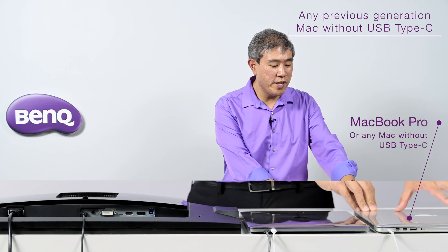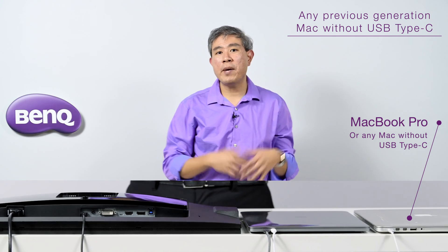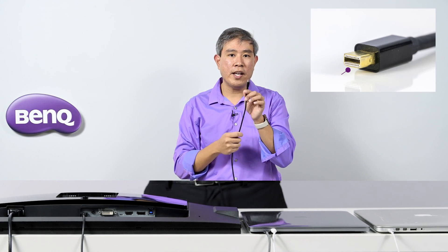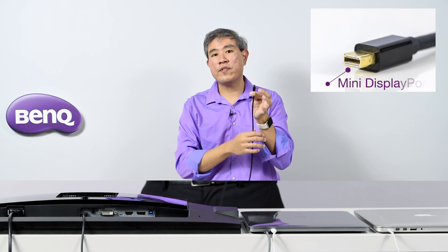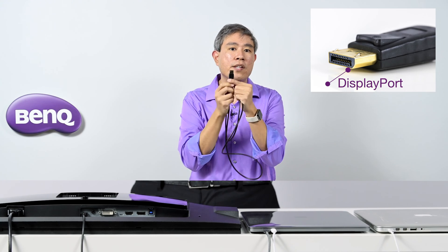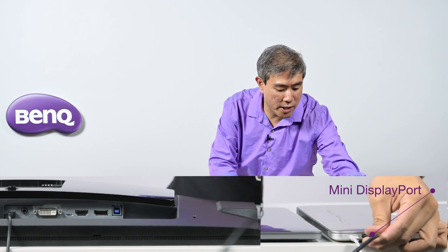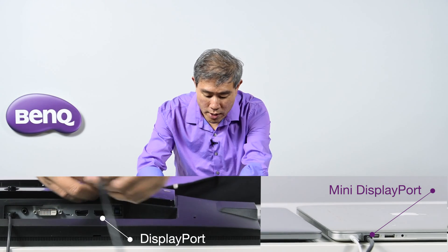Now I'm going to focus on my 2015 MacBook Pro, or anything before that which has all the ports on the side. If you have an older iMac or Mac Mini this will be a very similar setup. BenQ has included the cables you need in the box. In this case we're going to use a Mini DisplayPort — the port that looks really small. It also looks very similar to the Thunderbolt 2 port because Apple implements Thunderbolt 2 over Mini DisplayPort. The other side of the cable is a full DisplayPort that links to the BenQ display. You plug the Mini DisplayPort into your Mac and the other end into your BenQ SW display.